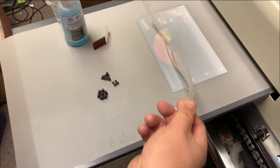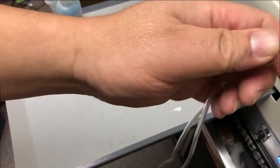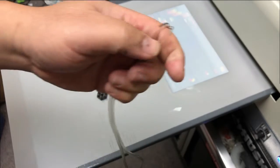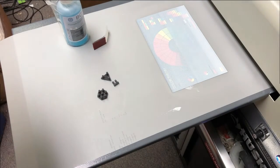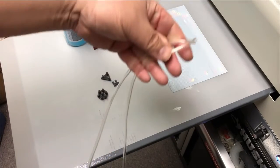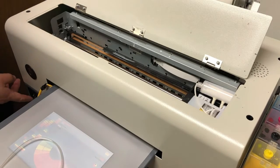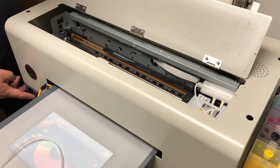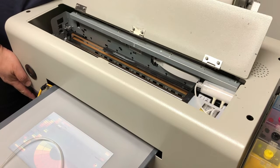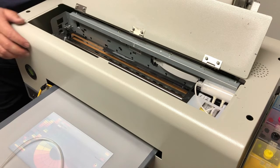I use these tubes, and each order is two feet, so I made two orders — that's four feet total. I cut it in half. We're going to use the Epson's built-in function to suck the cleaning fluid in, so we don't have to push. Again, there's nothing wrong with pushing the fluid; however, you have to be really, really skillful. If you push too hard, you may break the membranes between the colors, which may permanently damage the printhead. Using the printer's built-in function to suck it out is safer.